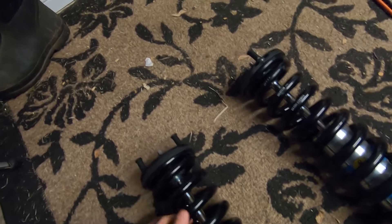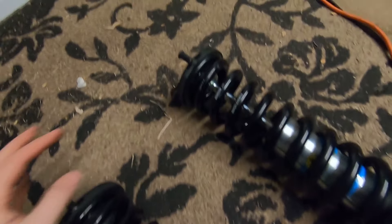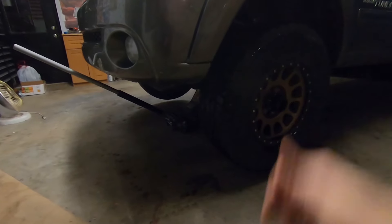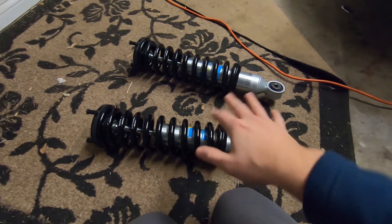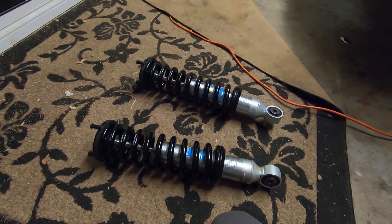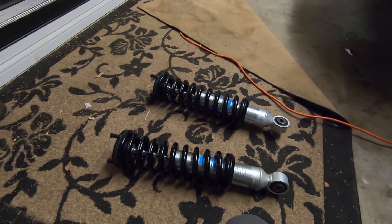I ordered brand new top hats — I'll put the link in the description. These are for the Tundra and I think they work for the Toyota application. So this entire assembly is brand new, same with this one as well. This is going to enable us to just take the old one out and plop it back in. There's almost no way to get around having someone else assemble these — you need a wall-mounted strut compressor tool, so take it to a shop. You have to have someone else compress these, in my opinion, at least for the Tundras.